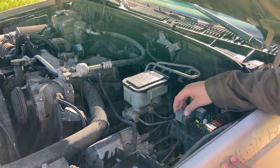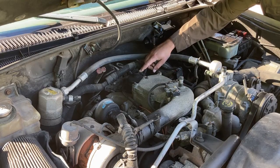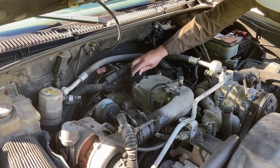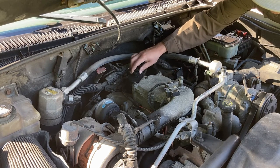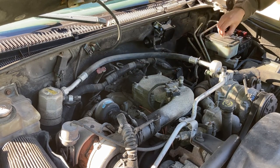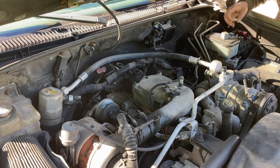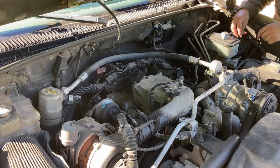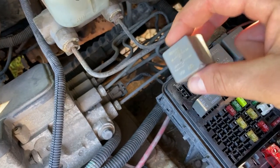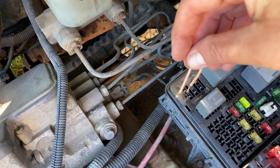You're going to want to check all these fuses. This right here is your fuel pump relay, and that's another one that's very easy to replace before you start buying a bunch of expensive parts. Here's your fuel filter — you can crack this on the top of it. I just heard a lot of air come out of that, which is a good sign as far as why it wasn't running. Now I'm going to jump across these two poles — this is the fuel pump relay, one of the first parts I replaced.